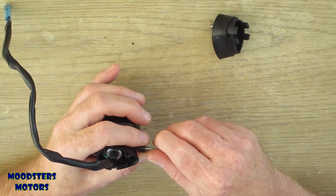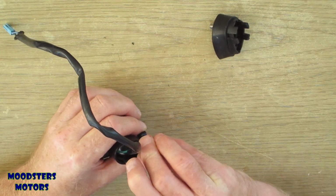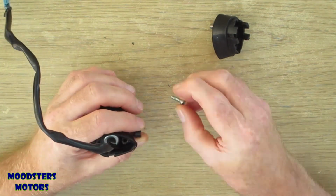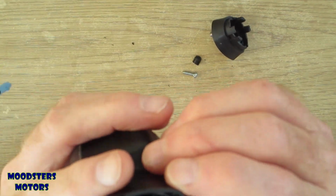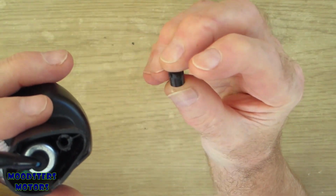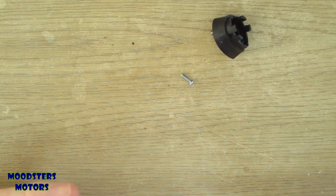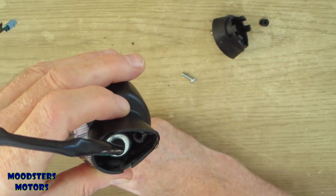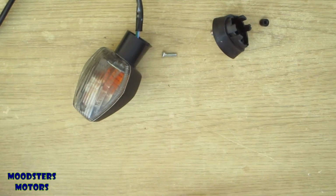You know, actually, I'm wondering, that hole is a lot deeper. I think I could use a longer screw and go right down into that hole. That's a lot deeper than just the end piece there. I think what I might do, I'll get something to measure how deep that goes, a little probe, a needle or something like that, and see if I can use a longer screw, because I've got to replace that screw anyway.